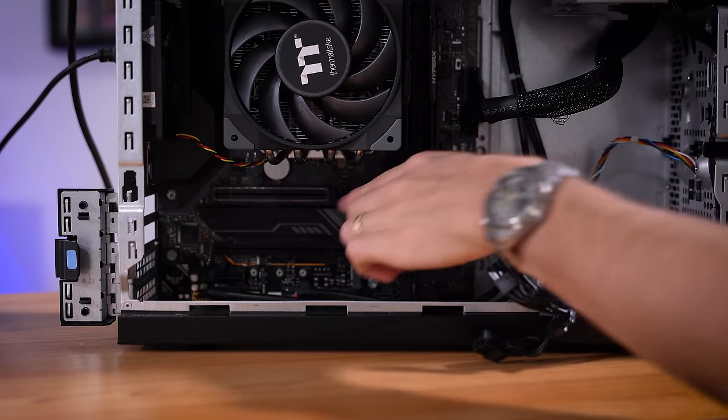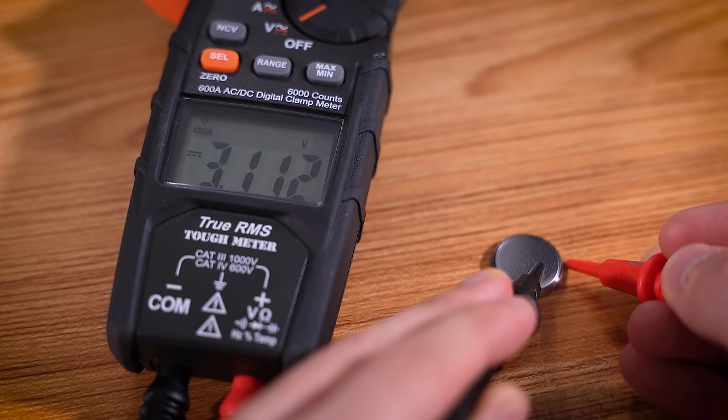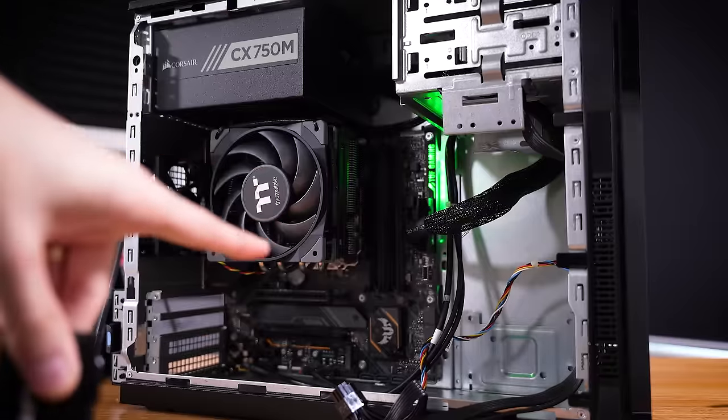I'll try testing battery voltage, although that's usually a very niche issue. We're reading just over three volts, so nothing wrong there. We've quickly removed memory from the equation — I've literally removed it here — and the system still will not power on.